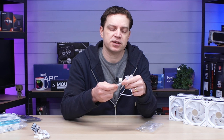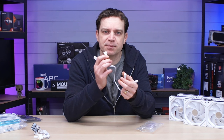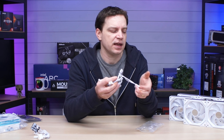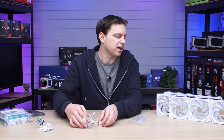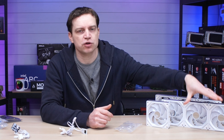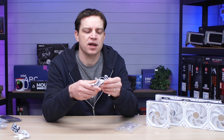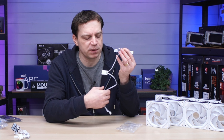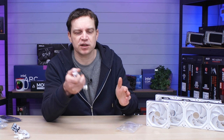They've also provided a four-pin PWM pigtail so you can string power along as well. One thing to be aware of when buying these kits: you'll need to design your layout carefully. If you buy two kits of three — say three fans at the top, two linked in the side, and one in the back — you'll only have received two of the connection cables. They said they plan to make connection cables available separately, so factor that into the cost.